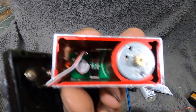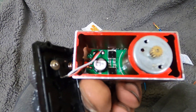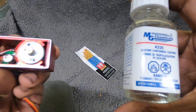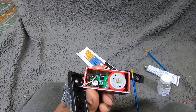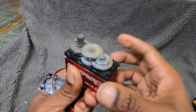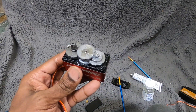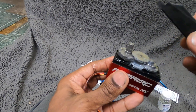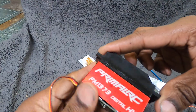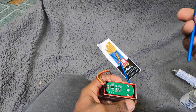Now the main point of this video: the inside of the servo. You can see I have a coating on it already — this is silicone conformal coating, and you really need this stuff on your servo. If you don't put it on there, water will get inside because water gets where it gets, and it will ruin your servo. Use your brush — I'm going in to get that back on there so I can start closing it up. You need a nice long brush for this.